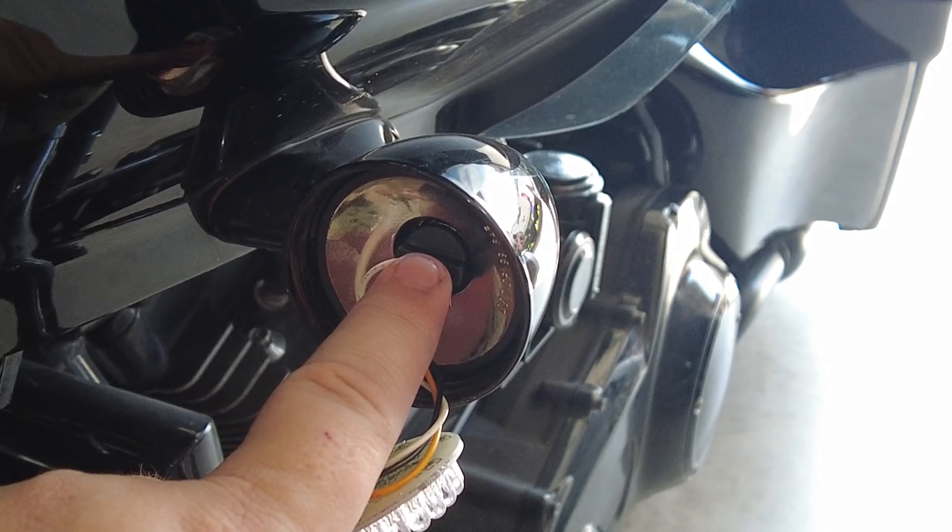This just pops off. The lens just pulls off — I can probably get it with my finger without even a screwdriver. If not, you put a standard screwdriver, turn it, and it'll pop the lens off. There you go. These are kind of cloudy and old, so we're going to set those aside — i.e., throw them in the trash can. Then these are just sitting in there, so you just take your flat blade or your finger, push and turn. There's actually a tooth for you to grab a hold of there. Push and turn — there goes the turn signal. Your stockers are going to have an amber lens and then a bulb — you just push the bulb, turn, and it comes out. Now you're ready to put in your Pro Beam.